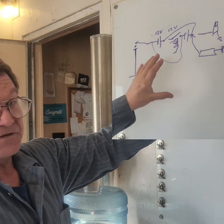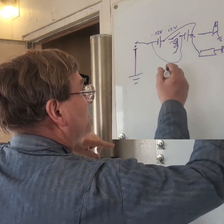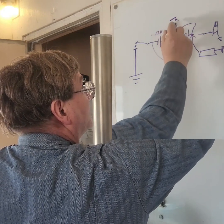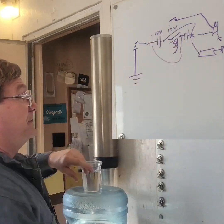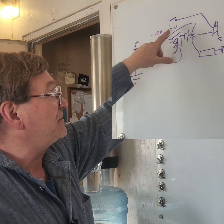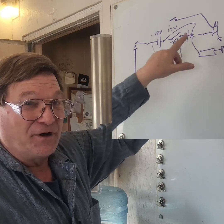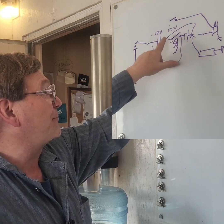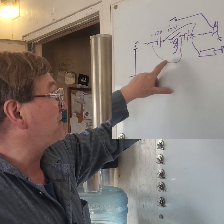One of the things when you see those — these are smaller wires, and there's one extra wire which is important. When this pulls down into the series-parallel, there would be another contact set, and this would go over to the solenoid so your solenoid could kick on for your starter. They did that as a separate switch because they wanted to make sure the series-parallel was engaged before the coil kicked on — you didn't want to kick the coil on and have it drawing high amperage through these 10-gauge wires instead of the battery cables.